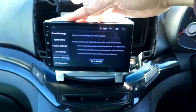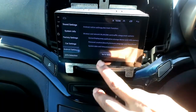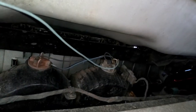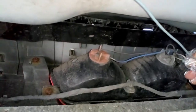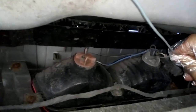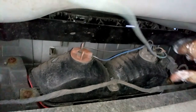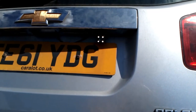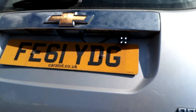I'm going to check under the car where I connected the reversing light with the head unit wire to see if there's any problem. This is under my car and this is the reverse light. It looks like it's not receiving power. After jiggling the wire just under the reversing camera, you can see now it works.